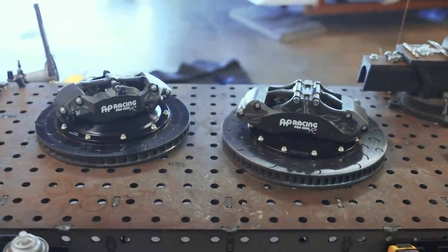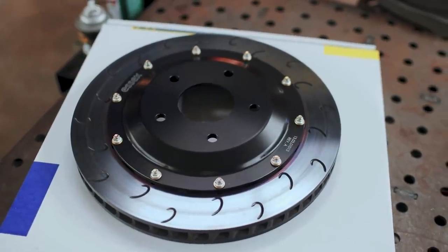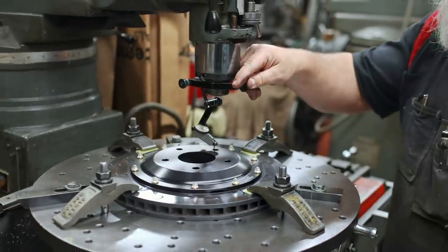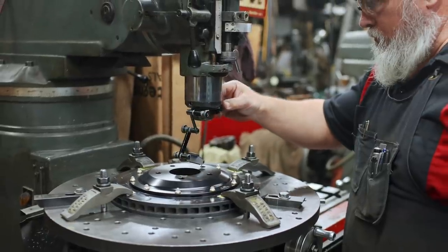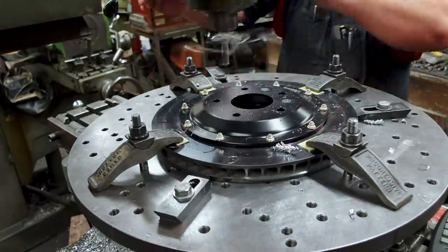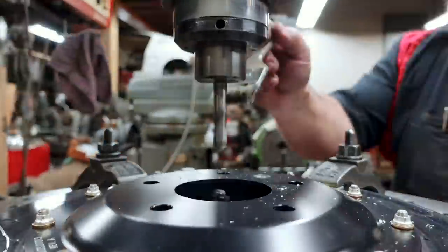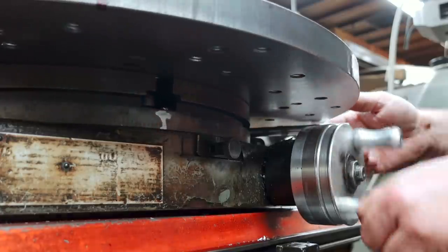It's been nearly six months since we got the big brake kit for the Ferrari. At the time we couldn't install it because the rotor hats were drilled to 5x120.65 — this kit was originally meant for a Corvette — and I changed my bolt pattern to 5x114.3, so now we need the rotor hats to match. I took the rotors over to my buddy Brett's shop, Nimmo Machine, where he set them up on the mill and converted them to have both bolt patterns in case I ever want to go back.